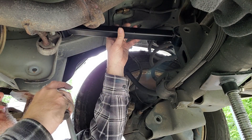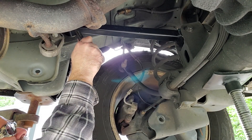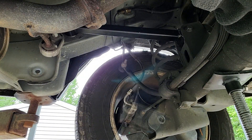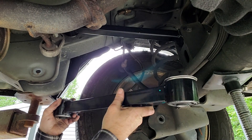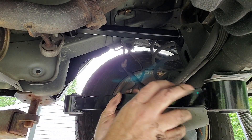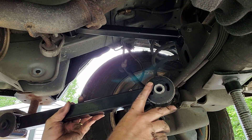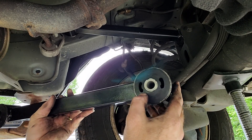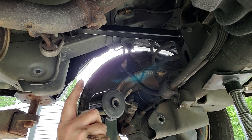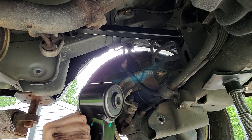We're going to stick the same bolts back where they came out. Now this is the lower arm. It's similar in that you've got a big washer on one side and it's orientated front to back by the way it's shaped. This round bulbous end with the little slots in it goes towards the back, and this solid looking piece goes towards the front. The washers where it's bigger on one side — that's going to go towards the inside.